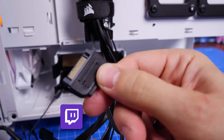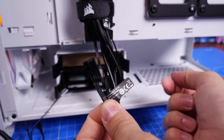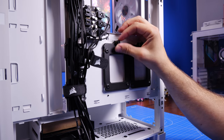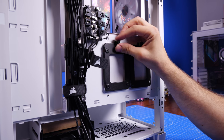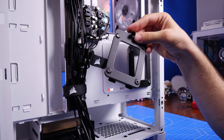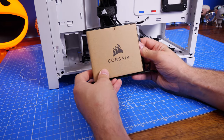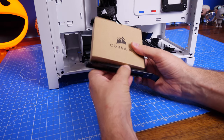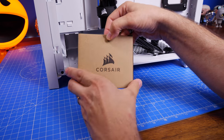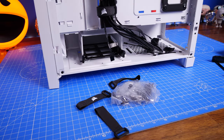The SATA power needs to plug into your PSU, and you'll also find the power connectors for the four fans. At the rear, there are two trays for 2.5-inch SSDs — you can mount your SSDs there or put the trays on the front of the case. This build won't use SSDs, but I'll briefly show what to do with a hard disk drive. Taking out the tray at the bottom gives access to the accessories box, which includes all the essential screws, cable ties, and other things you need. You also get some extra Velcro ties as well as plastic cable ties to neaten things up.